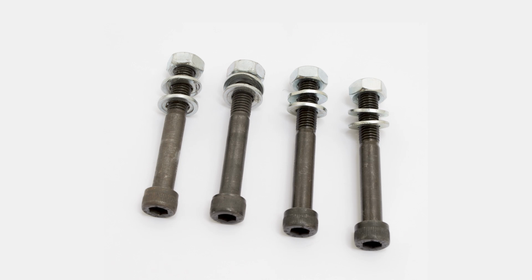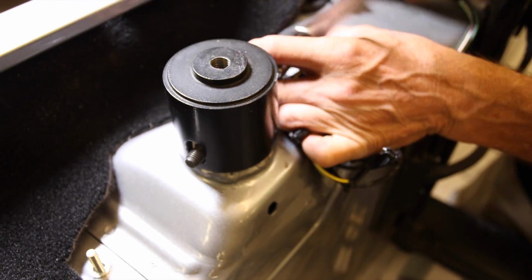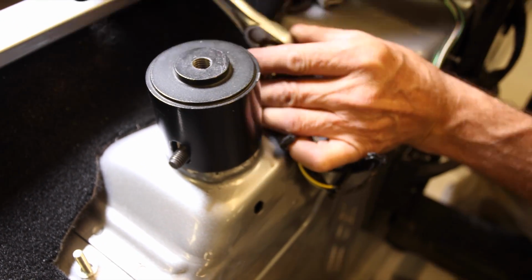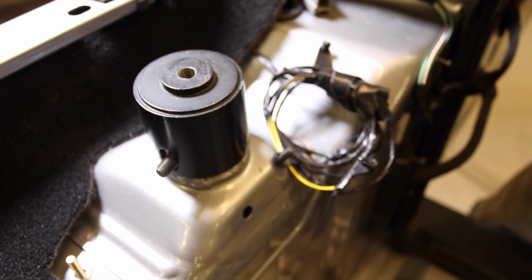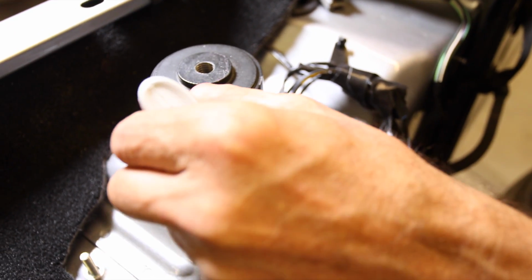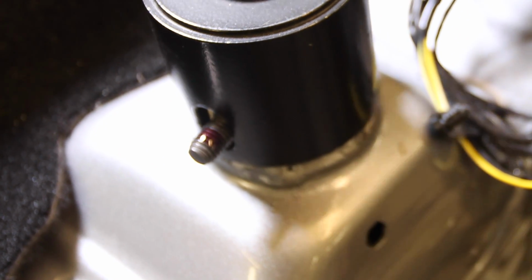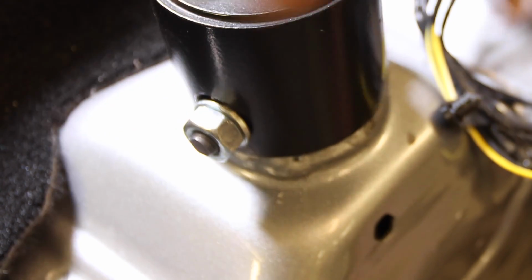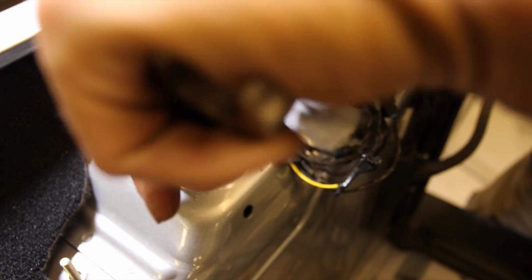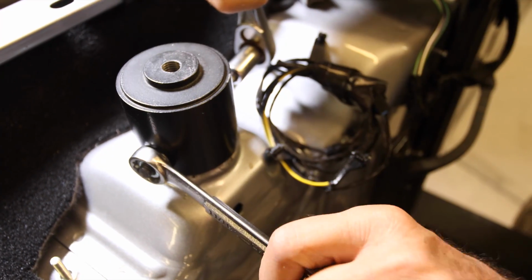Final fit the rear caps onto the sport bar mount and install the through bolt and tighten. Now, you may find that the cap tends to work its way up as you tighten, so just tap it down into place while protecting the threads. It needs to be seated and tight. When we bolt on the new sport bar brace, we don't want the surface of the tub to be pulled down to meet the newly installed sport bar cap. It would be unattractive. Bottom line, we don't want the mounting point for the cage to be very far off because of the way it would pull or push on the new fiberglass bed.